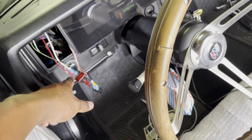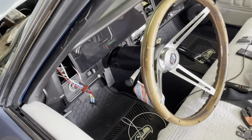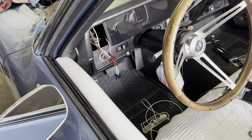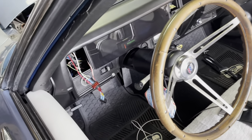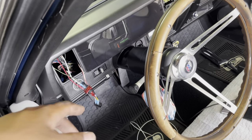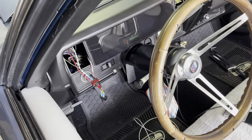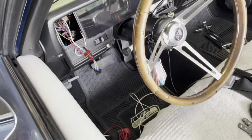Instead of the ground going to the switch, I had to hook up the accessory wire to the switch, and then hook up a 12-volt keyed power source — and that's how I wanted it. I only wanted it powered when the car was on, not off, because I'm not going to be running the fan when the car is off anyway. So I got 12-volt keyed-on hooked up to a 12-volt source underneath the dash, the accessory wire — which is the white wire going back to the relay and then up to the fan — and this is just the ground grounded to the car itself.